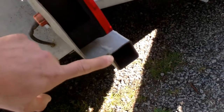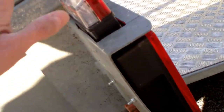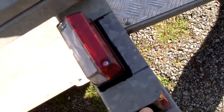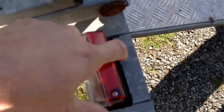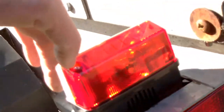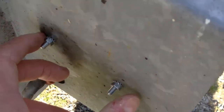However, mine were encased in a U-shape metal bracket, so the old lights used to fit inside there. These new ones arrived with the marker lamps on top, so I had to make a modification. All we did was drill the four corners and saw the shape out, filed up the edges, and then inserted the light at an angle up into the top. As I said, the same fixing holes, so no rewiring required - the plug is exactly the same. I did the same modification on the other side.